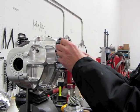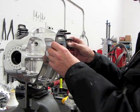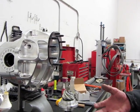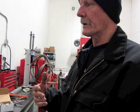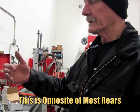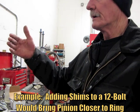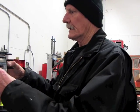When adjusting a 9-inch Ford: if your toe was too deep on the drive and you had a heel contact pattern on the coast, you're going to add pinion shim, which will pull the pinion out. That's going to have the drive-side toe start walking outwards and at the same time the coast will go down to the toe. That's basically what you're doing to adjust your pinion depth for your pattern.